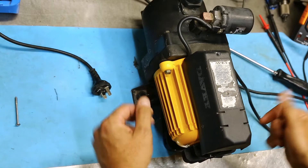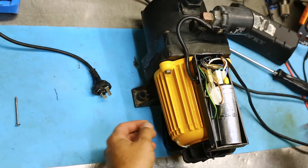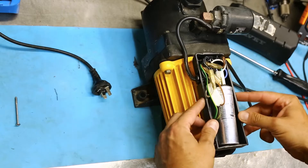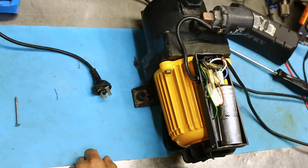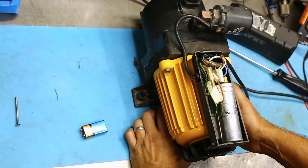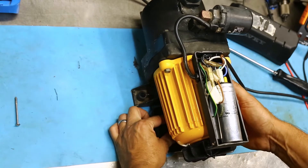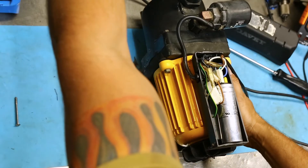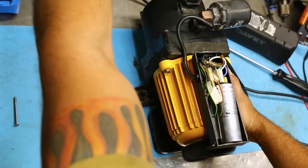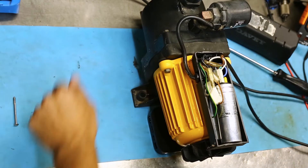Before I get it too far apart, I'll give you a bit of an overview of what it's actually doing. I probably won't be able to get it to fault completely. That's our capacitor there — it's a 12 microfarad, five percent tolerance, and that's what I believe is going to be the problem. I'll plug it in and turn it on — it'll probably work perfectly. You might notice it has just a very slight hesitation before it starts, sitting there a moment before it kicks up. It does need to start faster than that, so we'll unplug it.